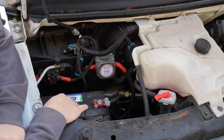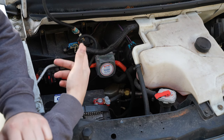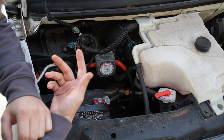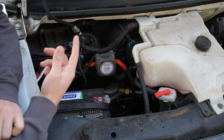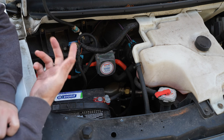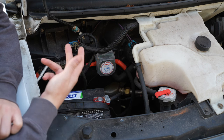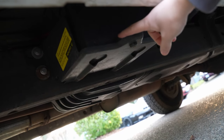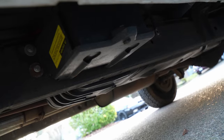This here is the starting battery for this van. This one's got a 5.7 small block in it, so it doesn't need a second battery like the diesel vans do to start. But we were able to buy the battery tray that mounts on the frame rail for the diesel van, and it bolts right into this chassis. In that tray we were able to drop a standard deep cycle battery.